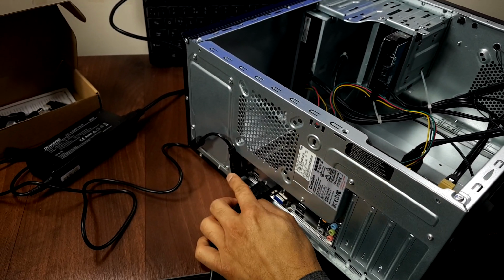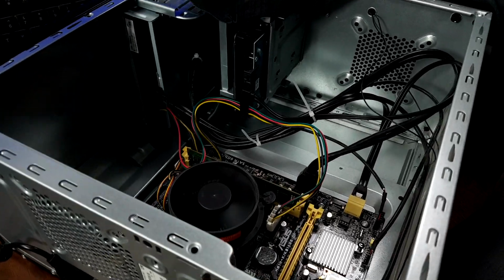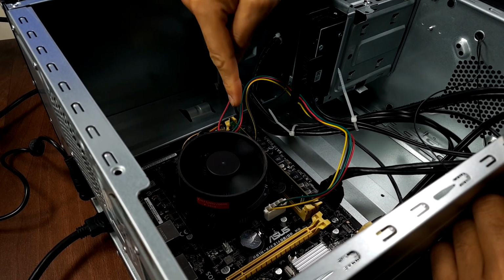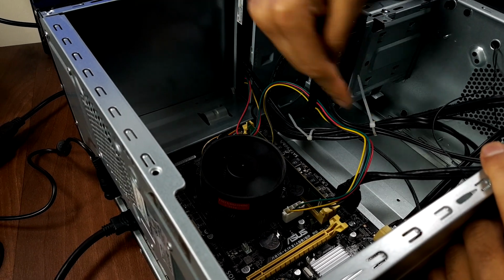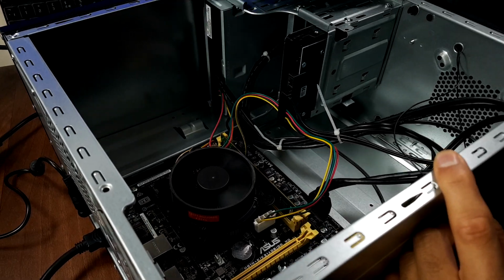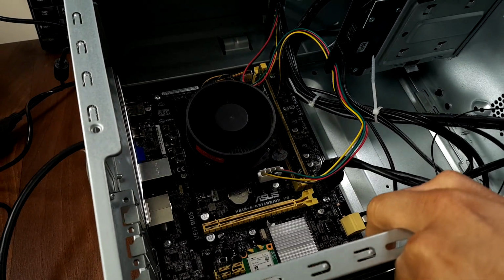So the client that I met actually bought this for, guess what, 450 pounds. Let's take a look at what we've got inside. You've got what looks like a motherboard for a desktop. Clearly there's a CPU cooler, a standard one, and a fan spinning there, so you might think it's an actual desktop component. In fact, it looks like a desktop component. The RAM is desktop RAM, 8GB DDR3 1600. Underneath there we've got a Core i3 dual core 4th generation. He bought this 3 years ago, and we've even got a little Wi-Fi module here for wireless, because of course we usually need wireless in desktop computers.